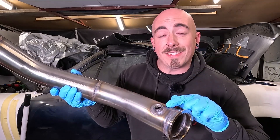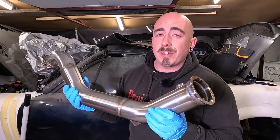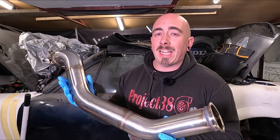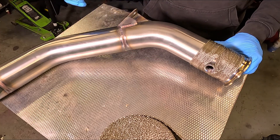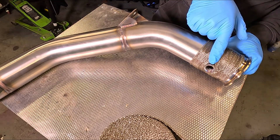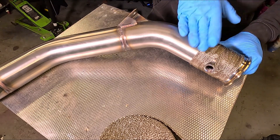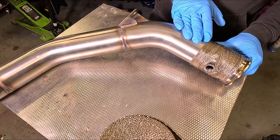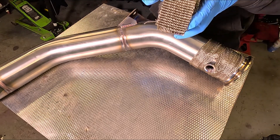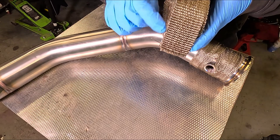But that does mean I'll be starting right where the sensor hole is leading straight onto the bracket. Once you've planned out how you're going to wrap your exhaust, give it a good clean as once the wrap's on you can't clean it anymore, so make sure it's clean of any contaminants. I'll be honest — I actually used some of the 25mm stuff to start off around here, as the gap between the sensor hole and the V-band was quite narrow and the 50mm didn't look quite right. But from here on up I can start using the 50mm stuff. From my previous experience I found this wraps better one way rather than the other — there is a slight edge to it and it looks better if you overlap on this edge.